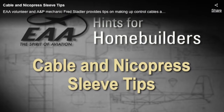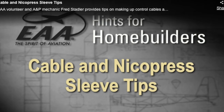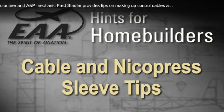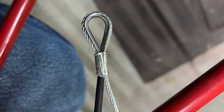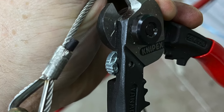But then I came across a video on the EAA website where they suggested that moisture could get trapped under the shrink wrap tubing and cause corrosion, and that that might not be the best practice. So for the rest of my crimps, I decided to just wrap the tail piece with the heat shrink and cut with my clippers as short as possible, like so.